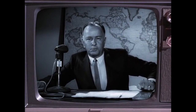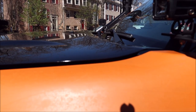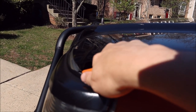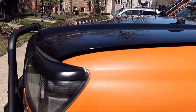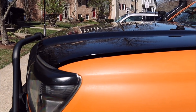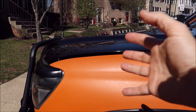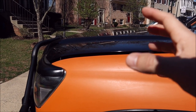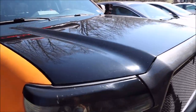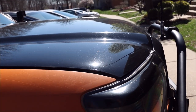Now back to the driver's side of the hood. The hood is closed — I haven't popped a latch or anything — but it starts out just a little bit and gets progressively worse as I go down towards the headlight. Maybe three-quarters of an inch gap right there; I can easily fit my finger under there. Eyesore for sure. I'm hoping the hood pin might help suck that hood down just a little bit, though my buddy said it didn't work with his truck and he has the same issue. If you guys know what's causing this please comment below — I'd assume maybe off-road stress, but it's weird how it's only pronounced on the driver's side. The passenger side has maybe a third of the gap.